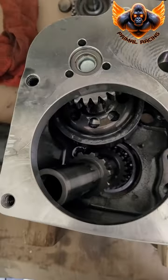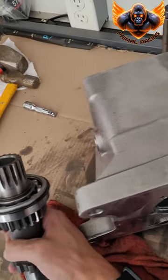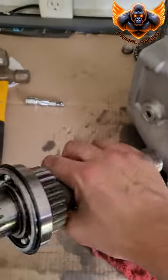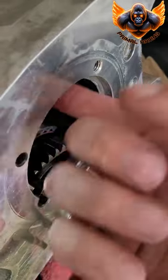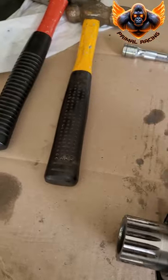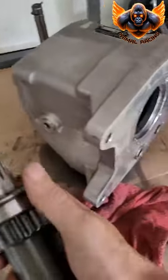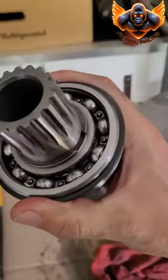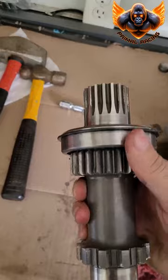It just falls right out. I was cleaning up the roller bearing and the whole main drive assembly. It has a roller bearing in here — I just made sure I didn't have any play after hammering on it. Some kits come with bearings; the kit I got just has the clutches and a few gaskets and seals. Just because this is so tight and hard to get out, check these bearings and make sure you don't have any play vertically.